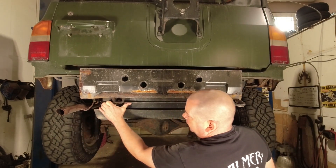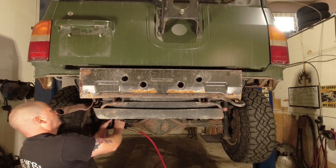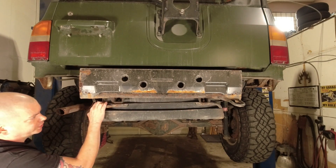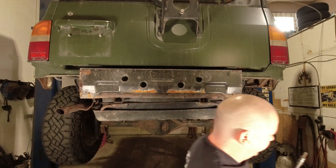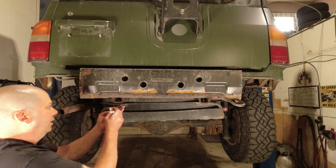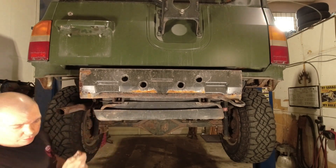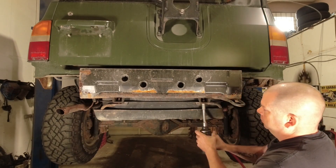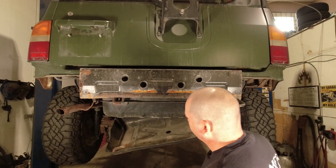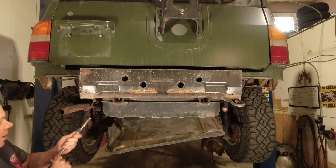This has dropped away less than I expected — I figured I'd be able to get the bolt back in there but I cannot. So instead we'll go to the forward mount which goes into the frame — that's also a 14 millimeter socket. This one does not secure the fuel tank, it only secures the skid plate, so now we can pull the skid plate down and get the bolt back into the fuel tank location. Use a wrench to tighten it and secure the fuel tank, and now we can do the other side. As you can see the skid plate drops away nicely and we have access to that bolt. I chased the threads on all but this one yesterday, so we only have this one left to do.